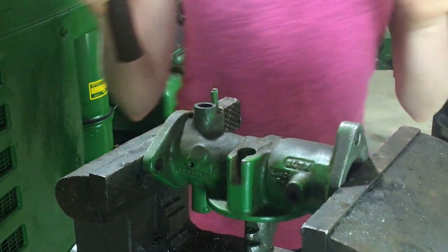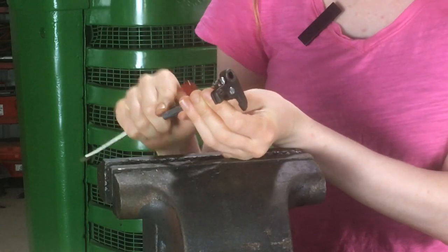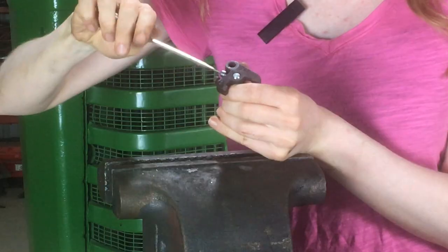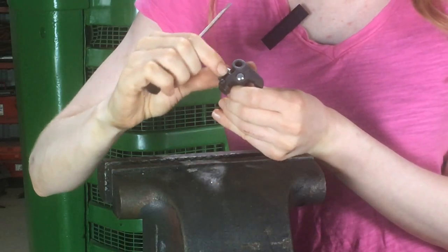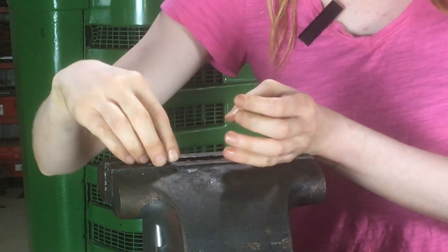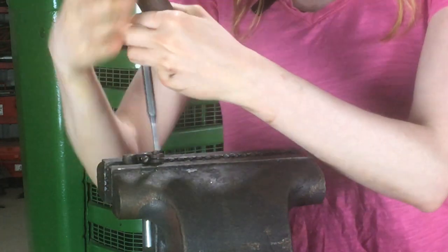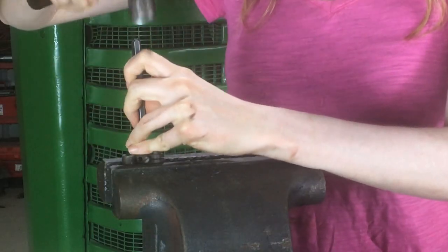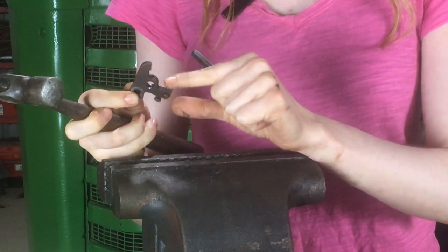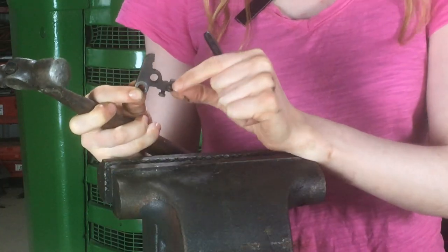I'll show you what the new one looks like — you can just drive that in and then put the felt on after it. To disassemble the throttle shaft, you'll need to take this screw out on the side. It's threaded first and then the pin runs through the shaft, so you take those threads out and then it will pull out. I have my vise here so I can drop this down into the vise — it's just resting on it to hold it there. Then you can use a small punch to punch that shaft through. If you break your linkage assembly at all, this comes as a new replacement part that you can purchase.